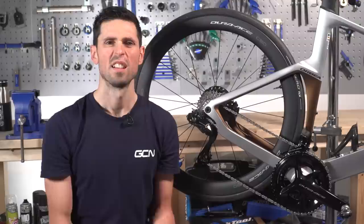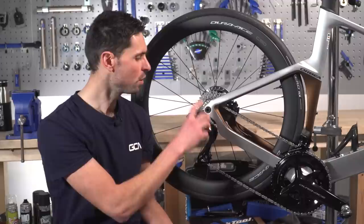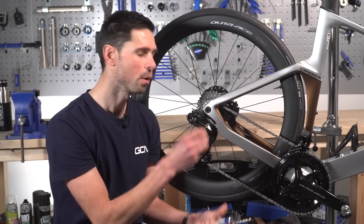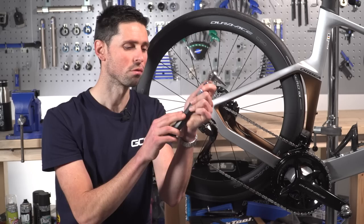How do we actually go about using our torque wrench? First up, we're going to need the relevant socket or bit to go onto the end of our torque wrench to fit on the component that we're going to tighten up. On my bike already, I've loosened off the bolt which holds the derailleur onto the mech hanger itself. I already know that it's a 5mm hex or Allen piece that I need. I can click that onto the ratchet itself — fairly simple. Then we need to set the torque wrench to the setting of that bolt itself. I already know that it needs to be between six to seven newton meters.